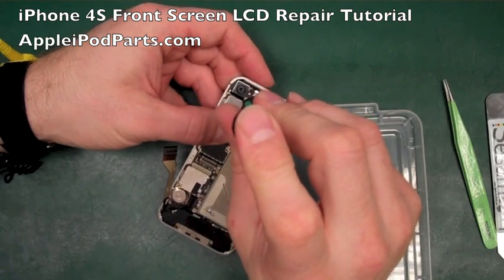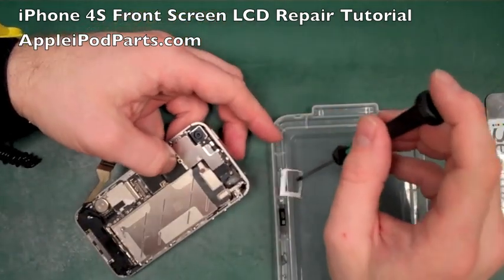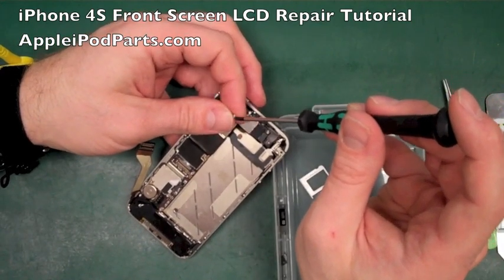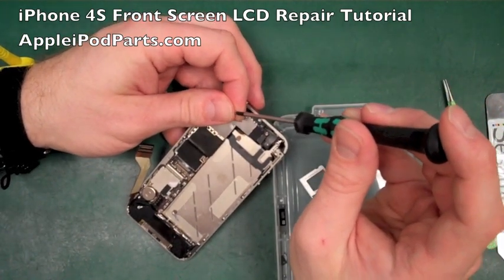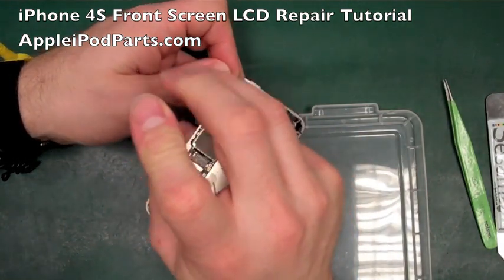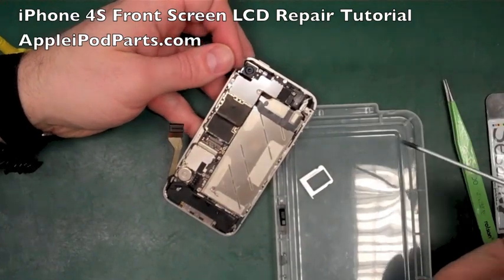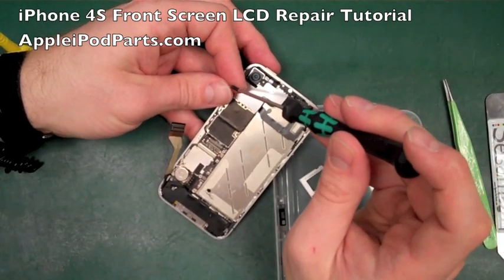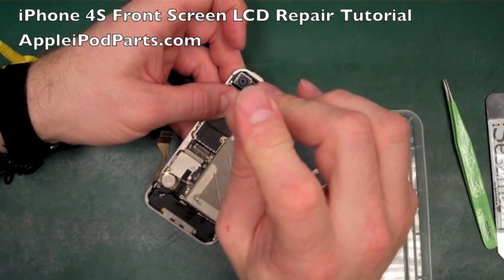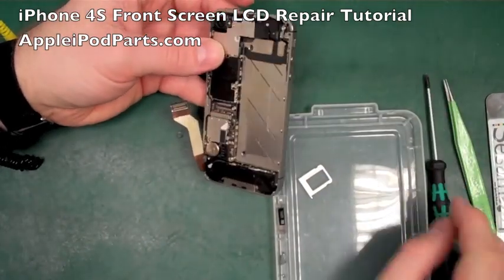Don't over tighten those because they've got tiny little lugs underneath them. On the iPhone 4 it was common that you used to break the little lugs off of the board, especially in that screw there. And that was the one that actually strengthened your Wi-Fi signal. So if you ended up missing that screw out, then you ended up degrading your Wi-Fi signal. So just nip them. Don't really tighten them, especially if you've got to undo them again at any point.